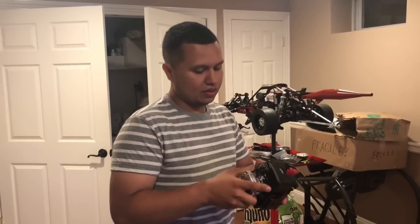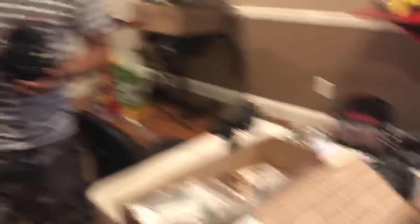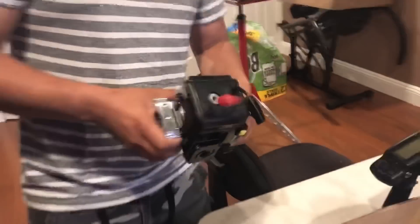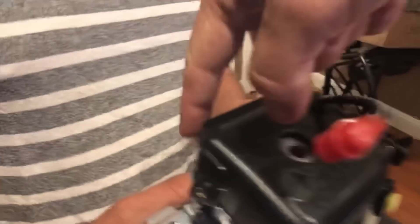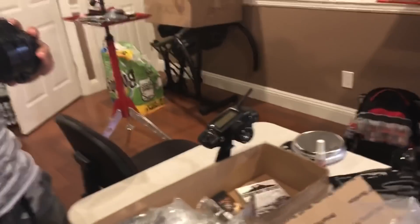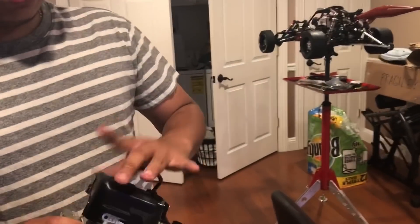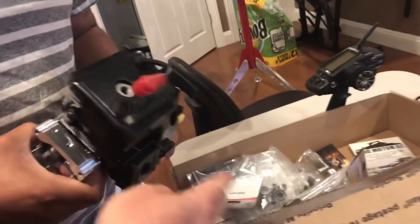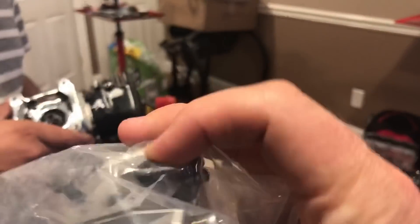So wrap her up, bring her home, keep her nice and snug. If I were you, put the spark plug in and put a little tape here - since you're not going to install the engine tonight, just close this up. Throw your carburetor on right away if you want, but we don't have a velocity stack here. Do you have a velocity stack at home? If you did I'd put it on right now. You have a torque wrench at home? Yeah - 65 inch pounds, that's it. Make sure the carburetor is on with the velocity stack and your gaskets - you just need to get the velocity stack and the gasket.